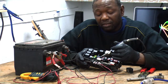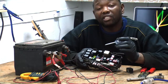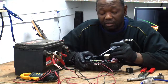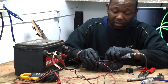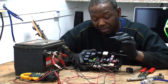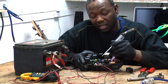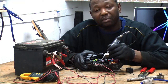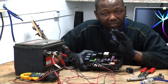Let's say you're stuck somewhere — you went on a trip, or you're at the grocery store, and someone boosts your car but puts the cables on wrong. Don't panic. First thing you're going to do: check your main fuse. Open the fuse box and check the main fuse. The top of these big fuses can come out — you unclip it and take out the top. If you don't have a replacement fuse, look at the two contacts inside and see exactly where it's broken. All you have to do is bend the two of them to make them touch. When they touch, power will come back into your system. Then you boost your car correctly and after that, go to the garage and get the fuse changed. That's one way it can save you a lot of trouble.